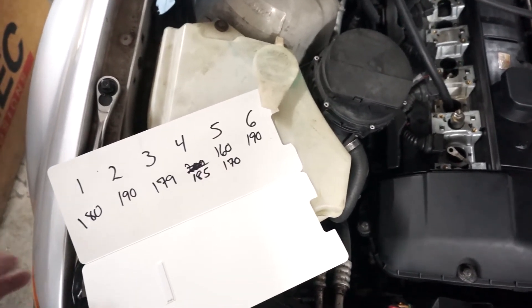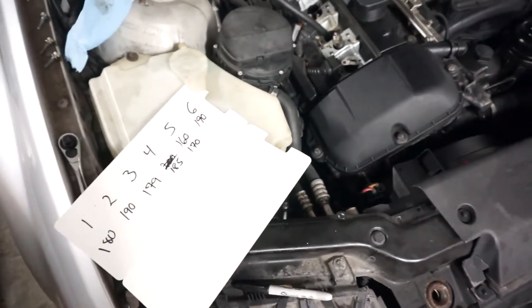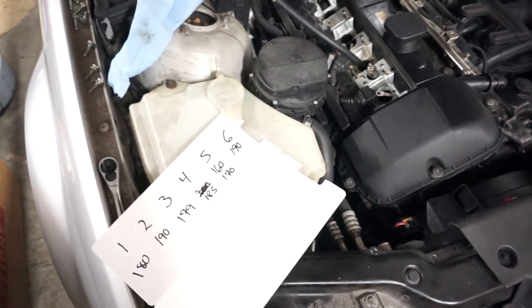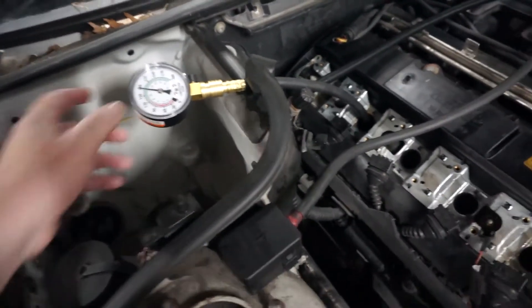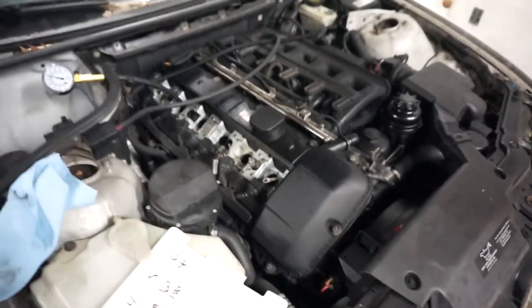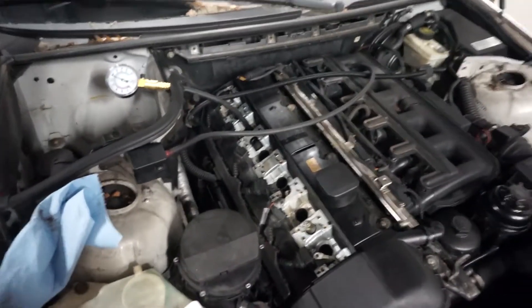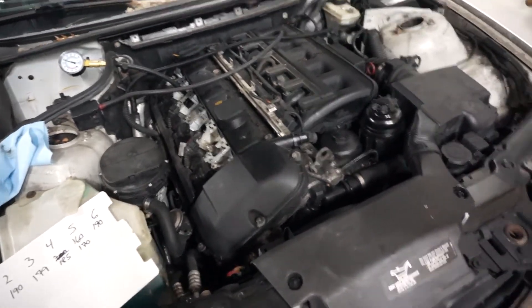If there's a weak cylinder in this car it's number five, but I think all these numbers are even enough that the car should run okay. The most likely cause is probably electrical in nature, or it's because of the mismatched spark plugs, or because of that broken spark plug that was at number five. I tested number five again and this time it's almost 180 — that puts it in line with the rest of them. The difference is I did get the five cranks out of it; some previous tests were more like six cranks, and the battery charger kicked off right when I was doing that cylinder, which probably explains the discrepancy. Everything looks very even and very healthy on this engine, so I'm going to put it back together and end the video.